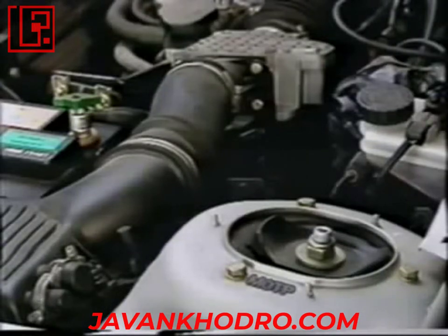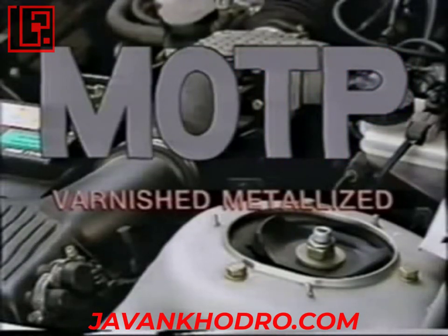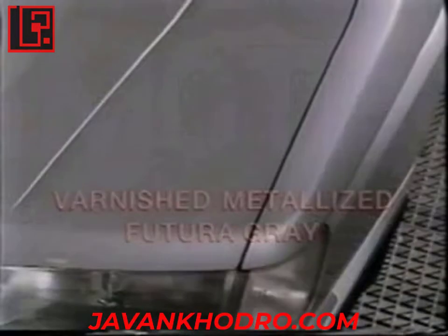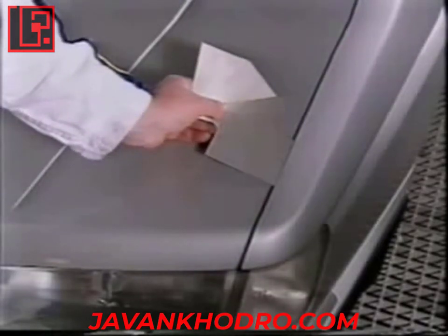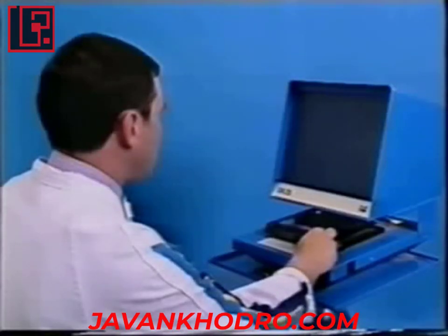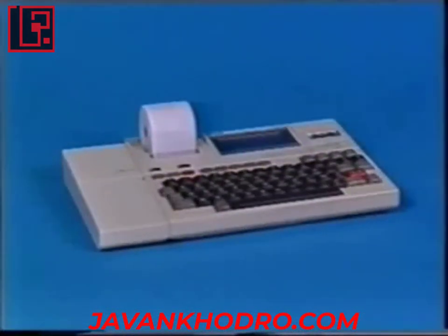Note the manufacture paint code on the front inner wing. The first two characters specify the finish type; the last two define the colour name. For this model, M0 stands for varnished metallised and TP is Futura Grey. The use of combined checking procedures makes it possible to obtain confirmation or to find the nearest colour.